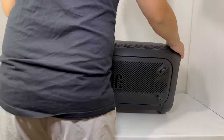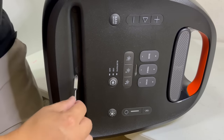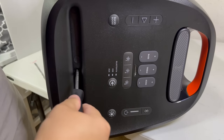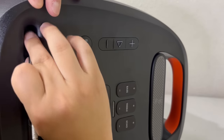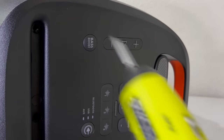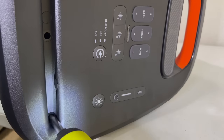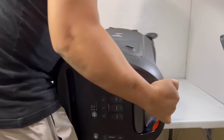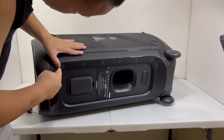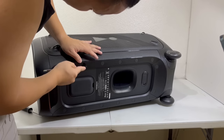Now with that done, we can take our attention to the top of the speaker. Hidden within the foam holder groove, there are three screws that will need to be removed. Now we will go toward the back of the speaker and take off 14 plastic circle covers so we can remove 14 screws. These screws are what hold the side and bottom panel onto the enclosure.